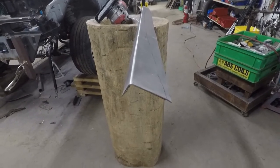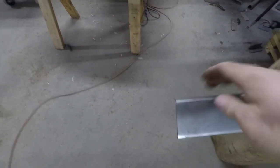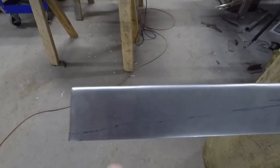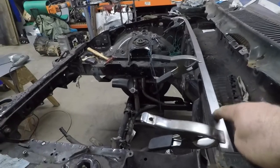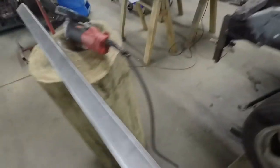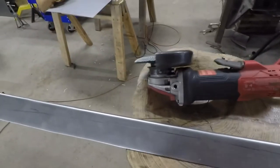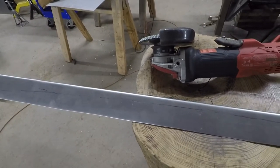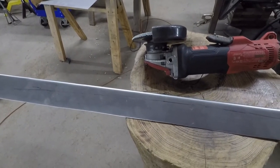I took a little piece of 20 gauge, about two inches this way, and put a three-quarter inch lip on it. I clamped it up in there and scribed it to the other flat piece. It doesn't quite go to the line, but it'll be a little bit off so I can do some fine-tuning. We'll cut that out and keep test-fitting it until it fits, and when it fits I'll show you.